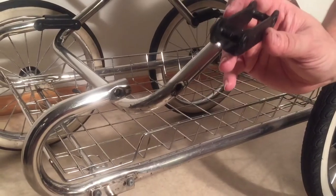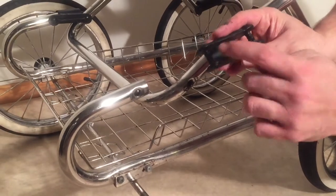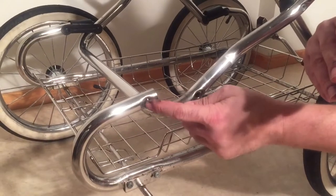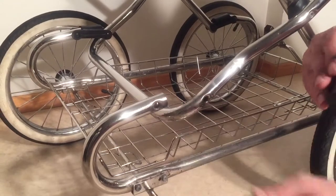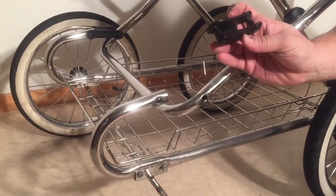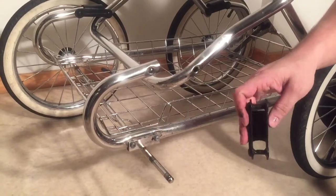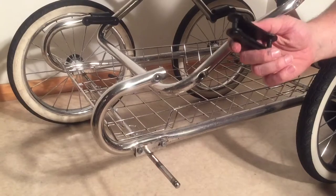If it is heavily worn, you're going to want to replace these parts, because what that damage does is bring the screw into direct contact with the metal hole, which can actually damage those metal holes. You'll also want to examine whether the hole has been widened out as the screw has pulled in. If the metal is damaged, you'll unfortunately have to replace larger portions of the chassis to get it tighter, but replacing these plastic parts will still help.